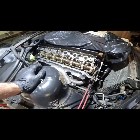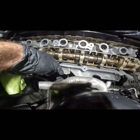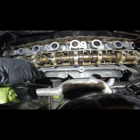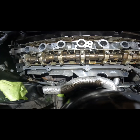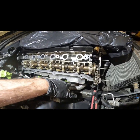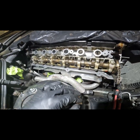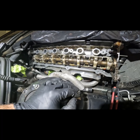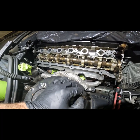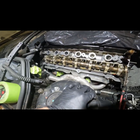Now that I have the exhaust on, there's a couple of things I want to take care of. The motor mount nut is right down here — I left that loose because you can't get on it once the exhaust manifold is in place, so I'm going to do that from the top up here. Now I'm going to work on getting the exhaust manifold bolted on. I put some green tape over the holes where the pre-cat O2 sensors go just in case I drop something — I don't want it to go inside the cat.